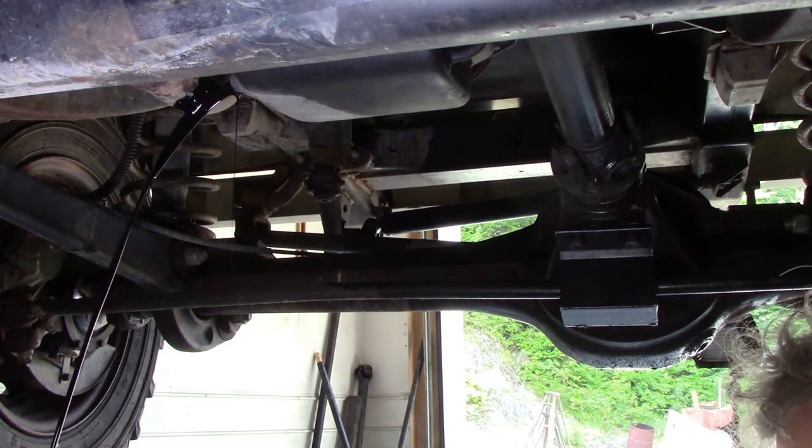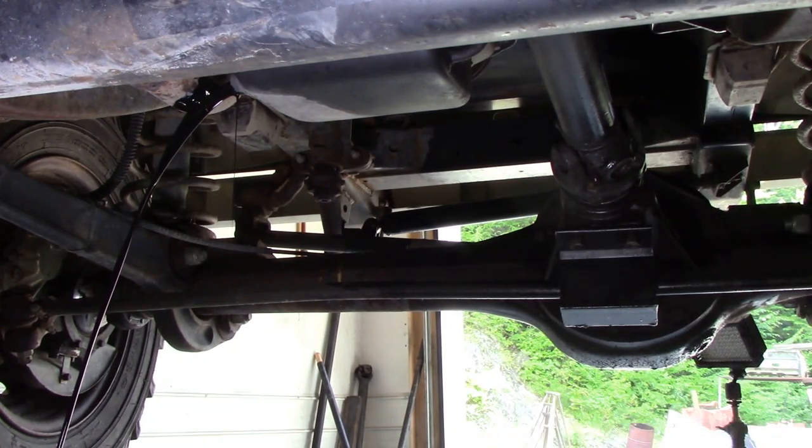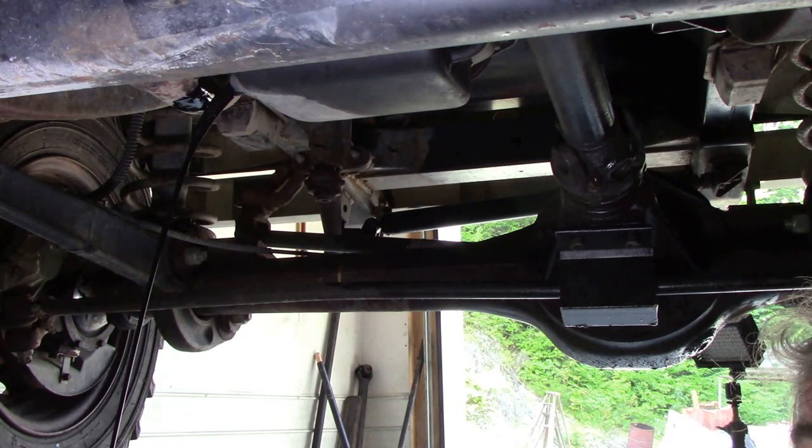This is why I charge so much for doing servicing - most of it is cleaning-up time. I think the oil was pretty thin because I had diesel in it from when I was checking out the cylinders. It isn't the end of the world, but it could do with the change - it's black and filthy. Then we'll drain off the swivel hubs once this is drained off.